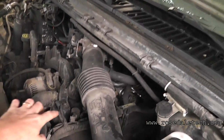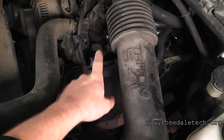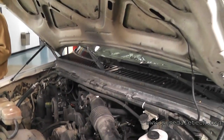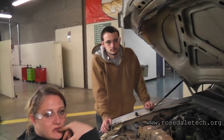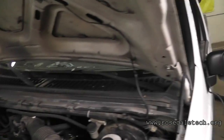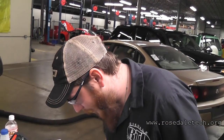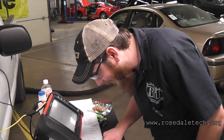You guys realize we don't have to go to number one coil. Just find a closer one. This coil right here is closer — one, two, three, four — this is cylinder five. Use that one. I understand why you wanted number one because I talked about synchronizing it with cylinder one, but we don't have to. Let's use number five. The layout of the diagrams are never really in firing order sequence — they just draw them the way they draw them.